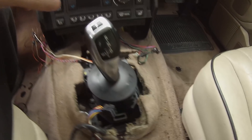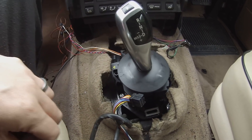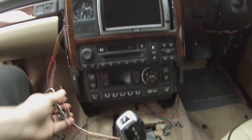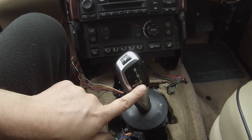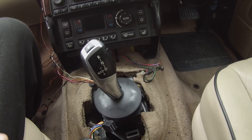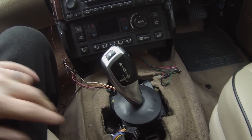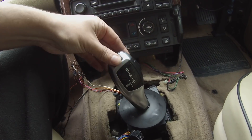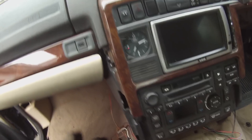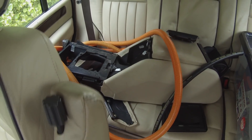I've got an E60 automatic shifter here which will fit pretty well into the space vacated by the old manual shifter. The beauty of it is that this baby is CAN bus, so we'll be able to send all of the shift commands over CAN to our trusty Lexus inverter. Once we get the inverter in, we'll be able to start sending messages to it. You have all kinds of weird functions, including burnout mode — where we can run the front motor forwards and the rear motor backwards — so that should make for interesting viewing.